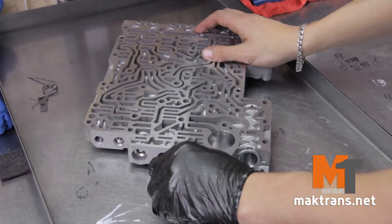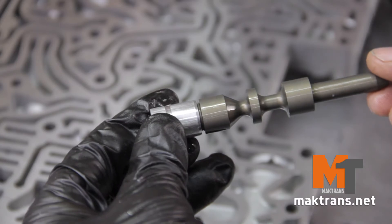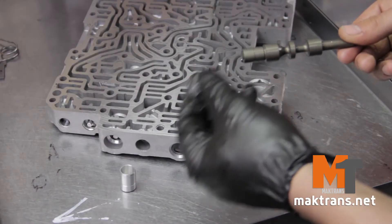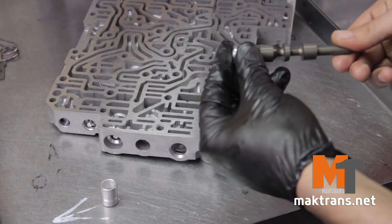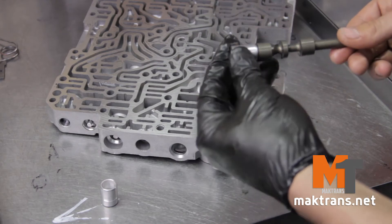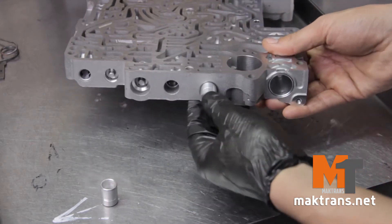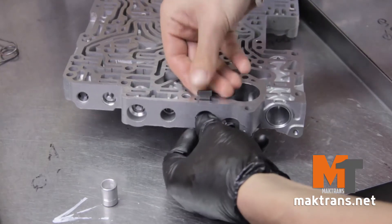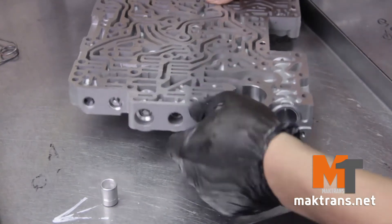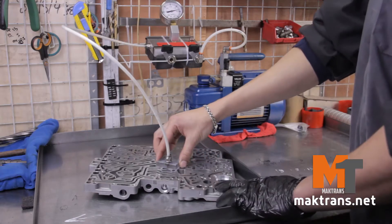The transmission kicks when shifting into drive mode. If the boost sleeve is in good condition but the valve itself is worn out, shifting into drive mode will be too sluggish. We'll replace it with a new one. Additionally, the 8HP valve bodies have problems with the influx. If the vacuum drops to 16-inch HG or lower, pressure losses will be unavoidable, initially causing jerks or slow shifting, which can end up burning clutch kits. These should be mandatorily checked and, if necessary, replaced with new ones.